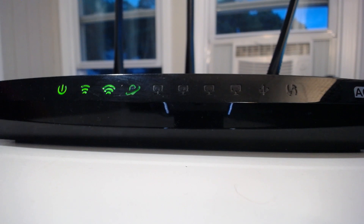And this covers all the lights in terms of their statuses. Everything else will be off or on, with exception to the WPS Wi-Fi Protected Setup light, which I described earlier. One thing to keep in mind is that your router's lights might look slightly different than mine, but they will likely have the same indicators. Your owner's manual for your router will usually break this information down, but it's useful to see it in person, as I showed you today.